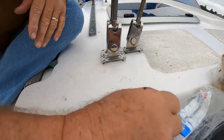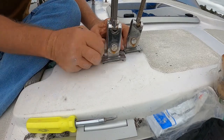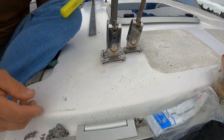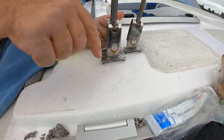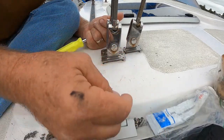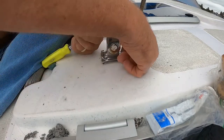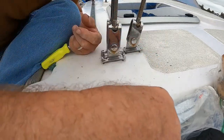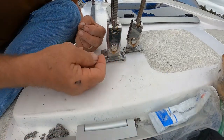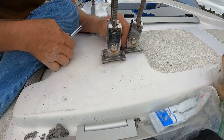All I've got to do is put my screws back in and tighten them up — should be good to go for another three years, I hope. I'm going to put all the screws in and tighten them up one at a time, all the way around, to compress them all at the same speed so I get an even compression. This butyl is going to squeeze out of the holes and fill any gaps, and then I can remove the excess.